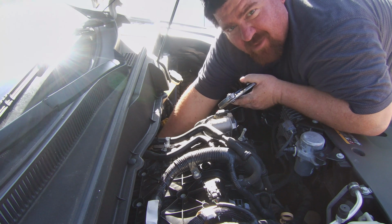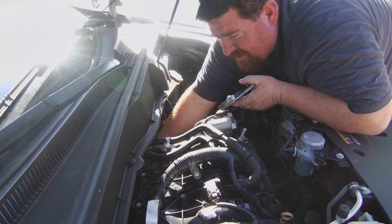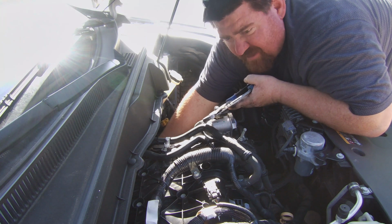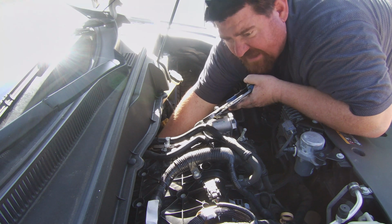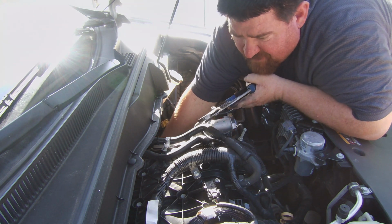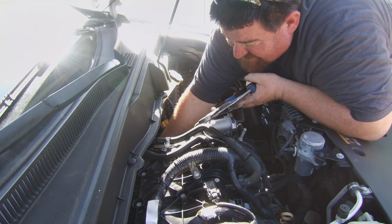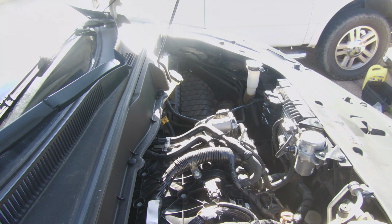I'm putting this hose clamp right below that lip on that hose barb there so that it can't slip off. That's what these big pliers were for. I lubricated the inside of this tubing heater hose and pushed it over that lip about an inch or so, enough to get this hose clamp on there and tie it. And with it in that condition, it won't slip off. It'll just pull up against that lip. And that'll be good.